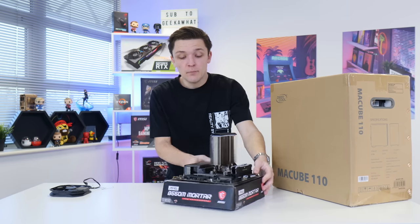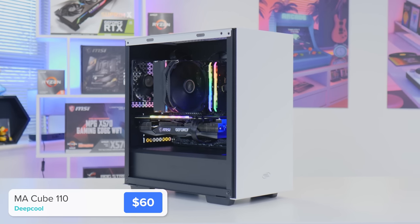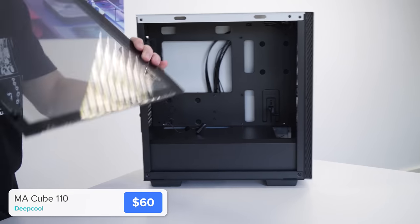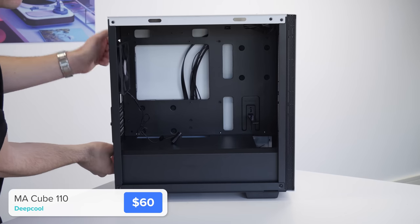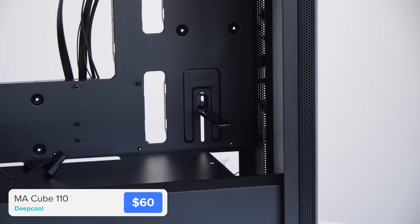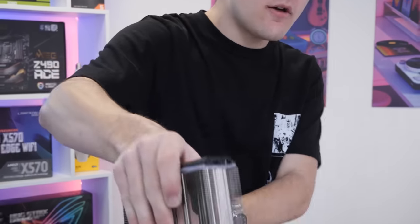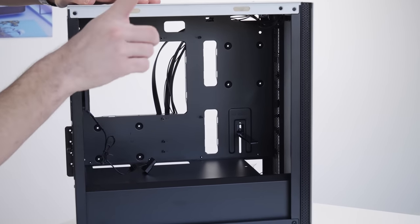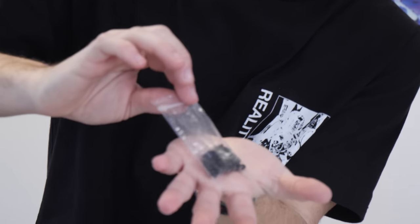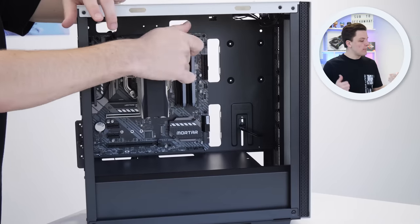It's time to move the motherboard into the case. The case is a new chassis from DeepCool called the Macube 110, with a cool two-tone white and black finish, a magnetic side panel that just comes off, and a GPU support bracket — very useful since our Gaming X Trio is a thick card. To install the motherboard, line up the holes through the board with the corresponding standoffs in the case — one standoff needed adjusting — then use the included screws from the bag at the rear of the chassis to secure the board. The built-in I/O shield means you don't need to worry about that separately.